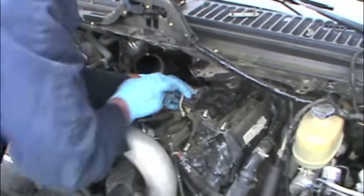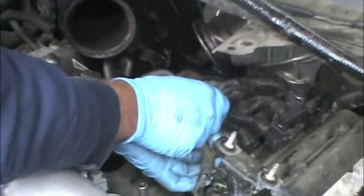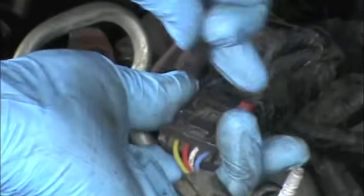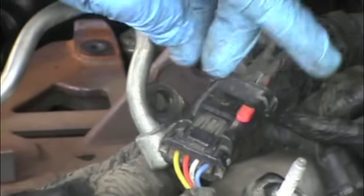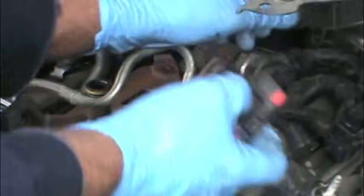Now on here, this is your glow plug wire. I just grab anything — a screwdriver, whatever you have — release it, push that back. When the lever's out, it works. I push it back through the opposite way rather than try to grab it through the clip.